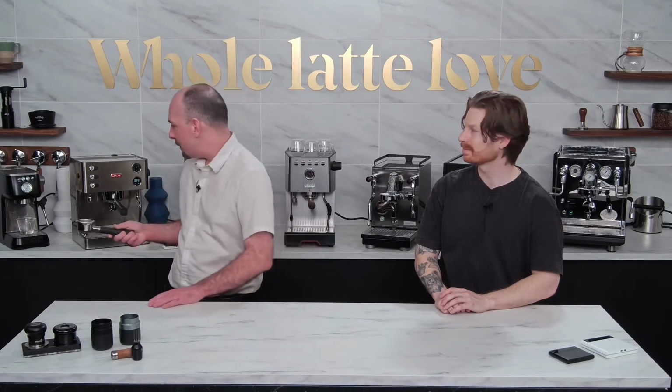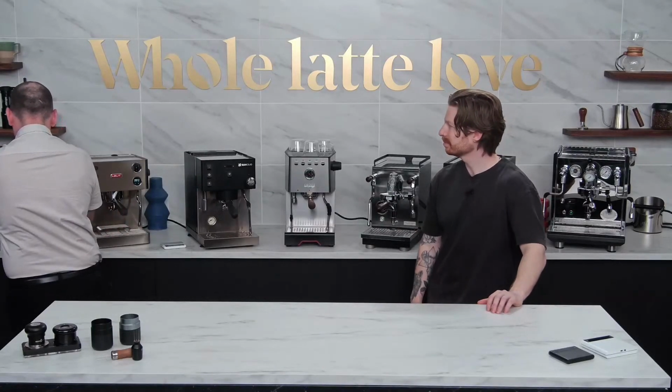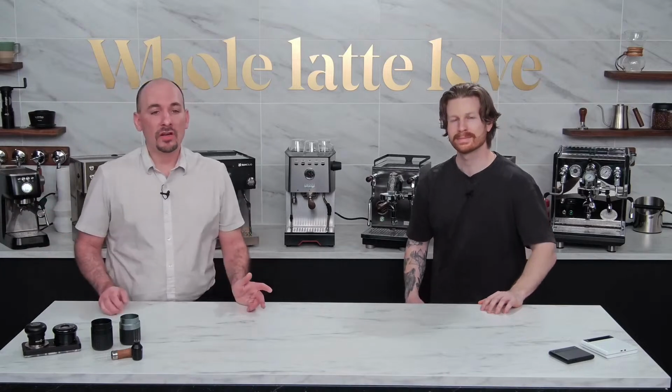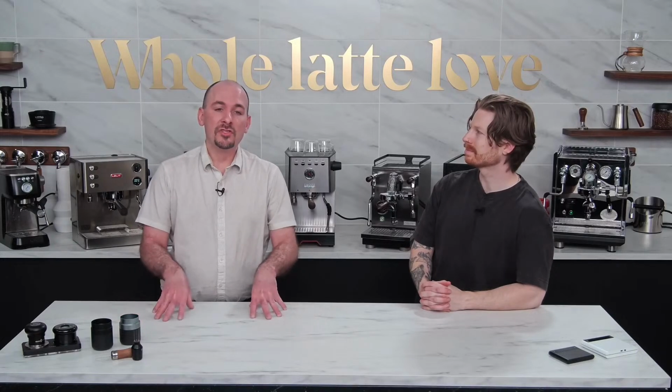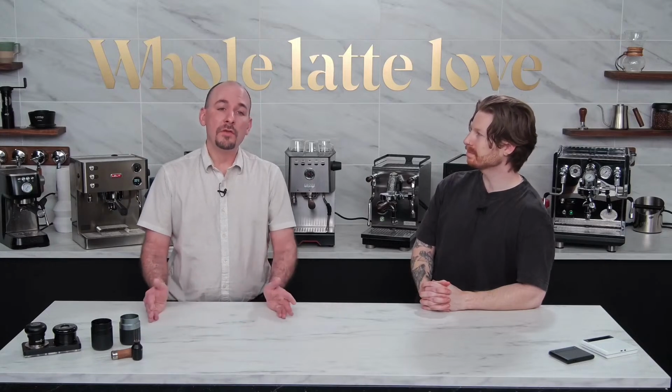And so like I was saying, in my tests, I found that it was about 15 grams of liquid coming out, followed by a brief pause. So that, like I said, is sort of how you're going to see pre-infusion on a lot of different machines. I don't have them all up here, but pretty much any of those thermoblock styles, like the new Fellow Espresso Series 1, will pre-infuse, if they have pre-infusion, in a very similar fashion.